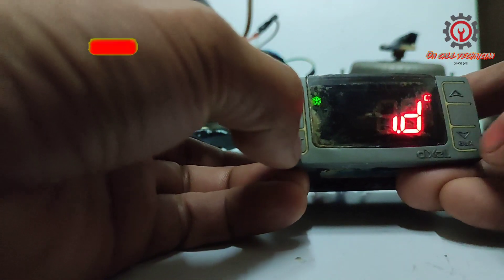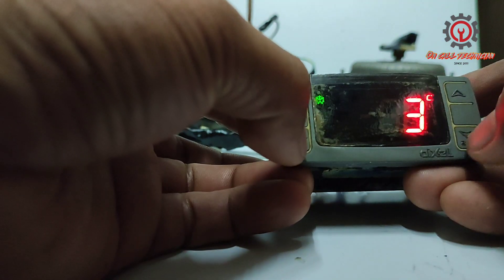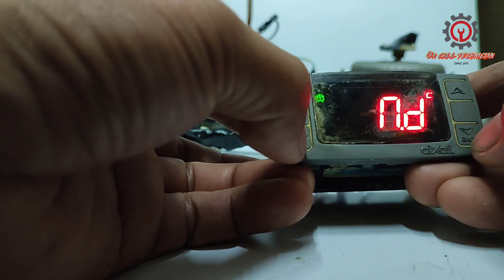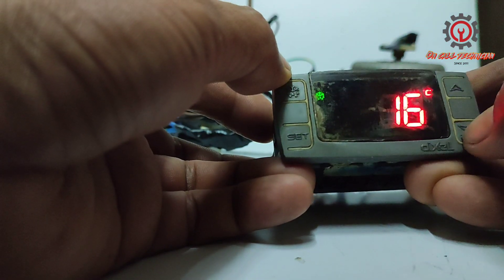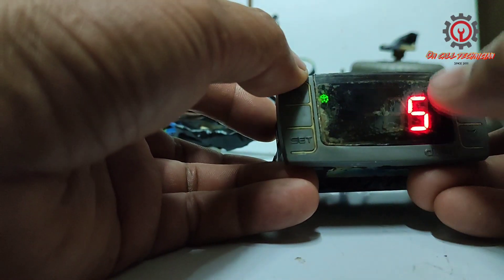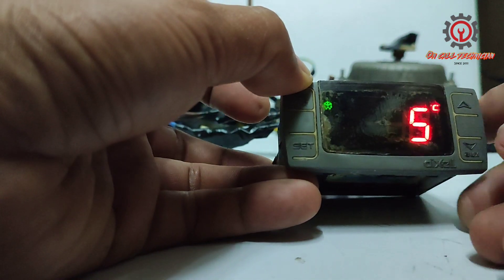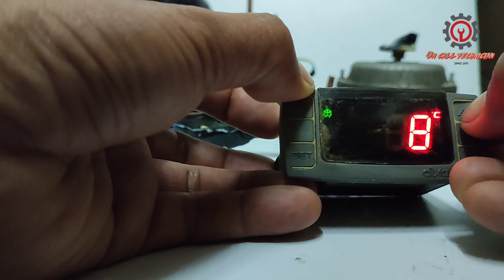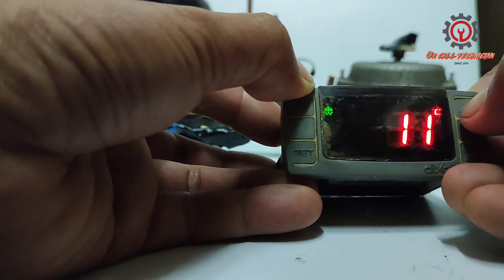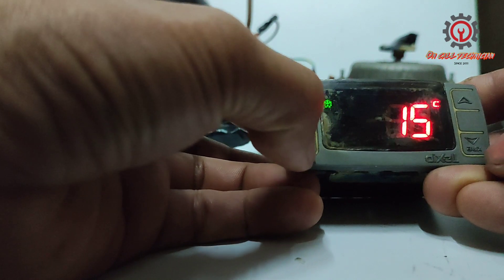Some newbies retain the six hours for the IDF and alter the defrost length from 30 minutes down to 10 or five minutes. Do not do this — don't follow what a newbie technician does. Even 10 minutes is premature and not the proper setting.